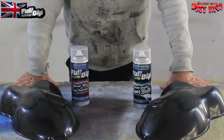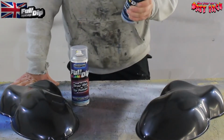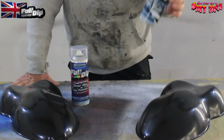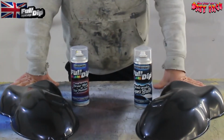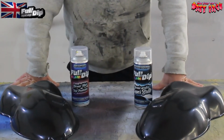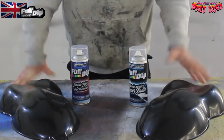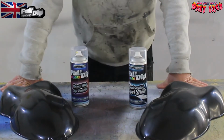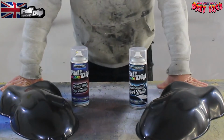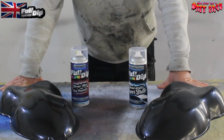For instance, a 17-inch wheel, let's say we're doing it gloss black, we would use a whole can of the matte black on a 17-inch wheel, and then just the 2 medium coats of the gloss. Peel absolutely fine. If you're only going to do one coat and do all 4 wheels with one can of black, and then you put this on, not going to peel. That's your own fault, you've got no sympathies. You can get it off, but it's a bit of a workup. So follow the system, put the correct amount of material on, and you'll be absolutely fine.